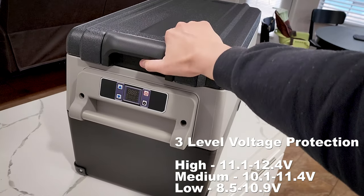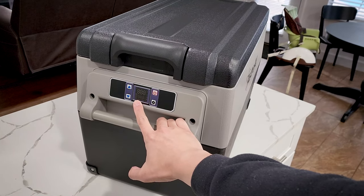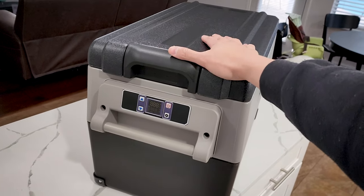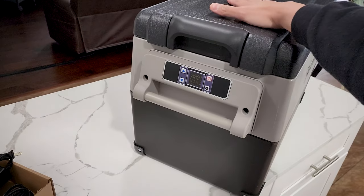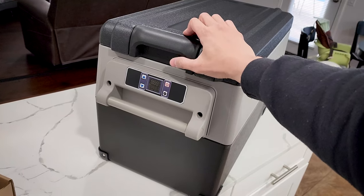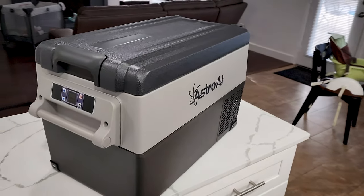Some units will just keep running and drain your battery. There's also a max and eco mode. On max mode the draw is 60 watts, and on eco mode it's cut down to 30 watts — really low draw. What you sacrifice on eco mode is just the speed of cooling, but that's not a big deal. You can run it in eco mode and be just fine. Best practice is to prime the fridge — plug it in at your house before putting it in the car — so it's already at temperature and not drawing too much on the battery when you're out there.